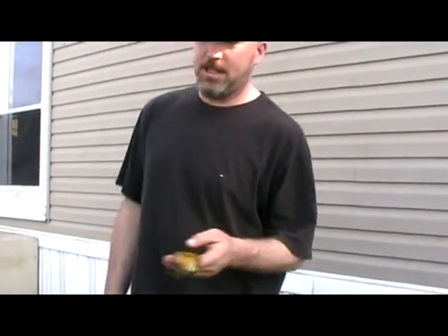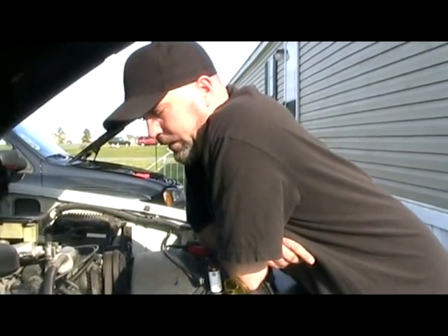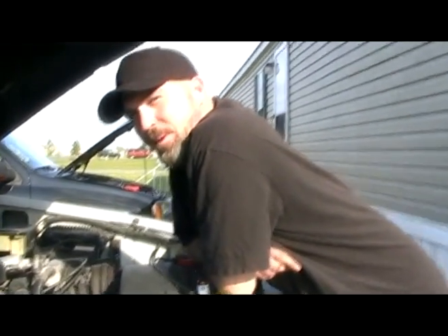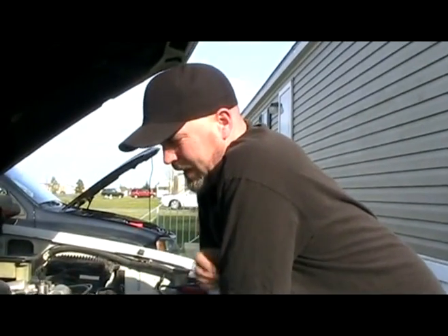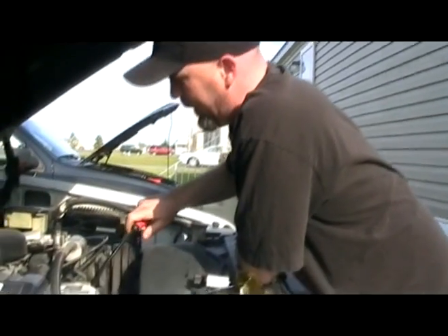This is an LED-type UV light. You also get some cool yellow glasses. On a lot of these 5.7s, you get a coolant leak and it always seems like it's dripping from the water pump. What I do is fill them up with the dye, come back with a black light, and look all around down in there by that intake gasket. It really helps to do this at night time because the leak will just pop right out at you.